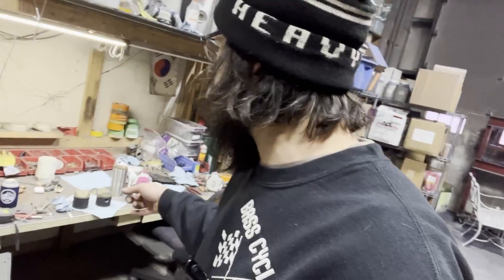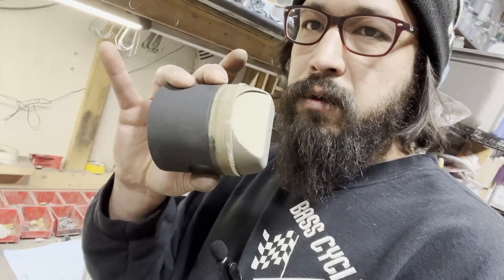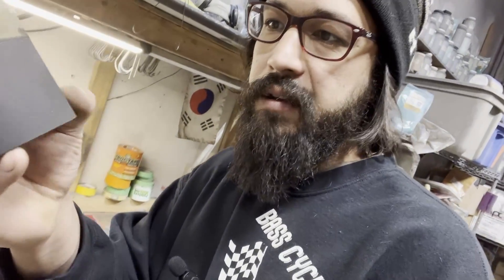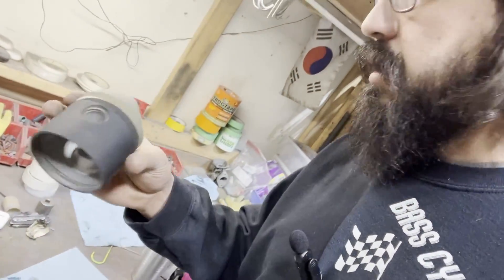We are back. Oven has done its cure cycle. Pistons have been in for about an hour or so. Yank these out — tape's still on, so I'm going to yank this off here in a minute. But now we've got the micro slick coating on the bottom side, got the piston crown coating on the top. Both of them looking super fresh and clean, super fancy, I guess. Same thing on the heads.